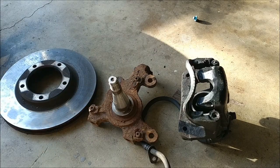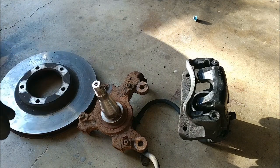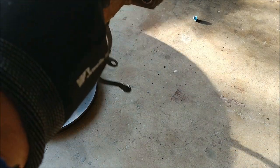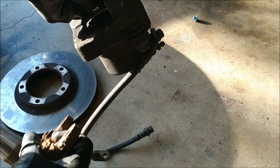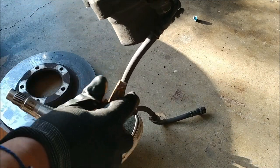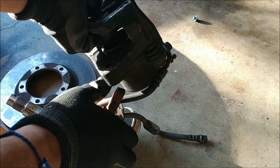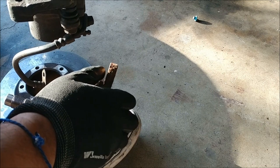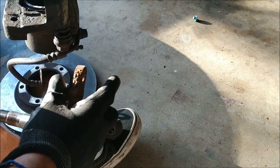I'm going to show you guys how to shim out the caliper using this old spindle and the stock caliper. Basically, you mount the caliper on the inside of the spindle. For the Brembos, there are two different shims or washers I used — one on the inside against the caliper to space it out and make it centered with the rotor. That was the larger one, I think it's like 3mm or something. I'll put that in the description. And then I put another washer on the other side so that the bolt wouldn't hit the rotor.